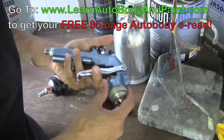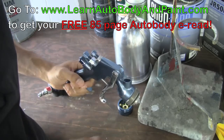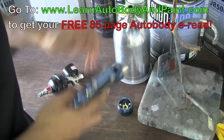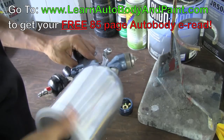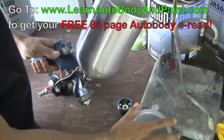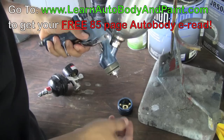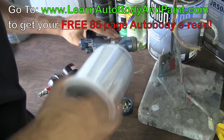Make sure to clean your gun after each use every time. It's not good to let clear coat sit in overnight when you're done with your paint job. What I usually do is keep the cup on, dump the paint out, pour some fresh lacquer thinner inside, close the lid, shake it a couple of times, squeeze the trigger to flush out the old paint, then get a toothbrush, clean it around the tip, take it apart, and clean it thoroughly.